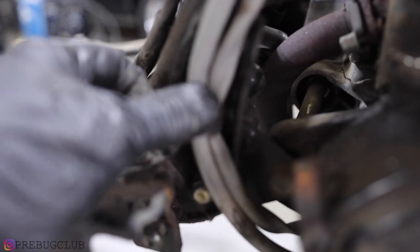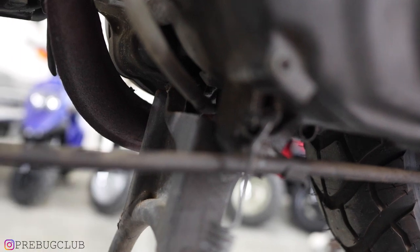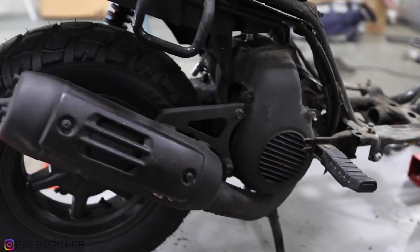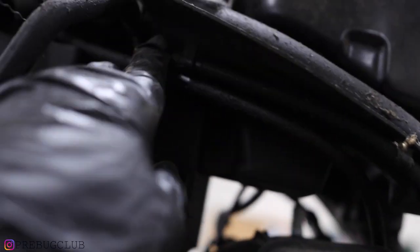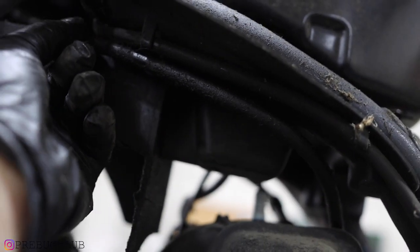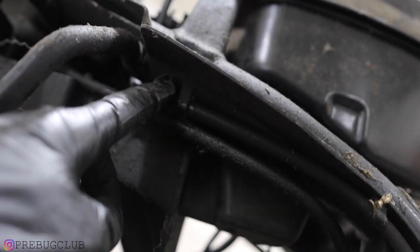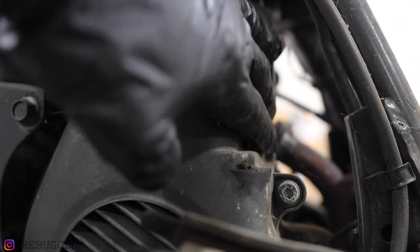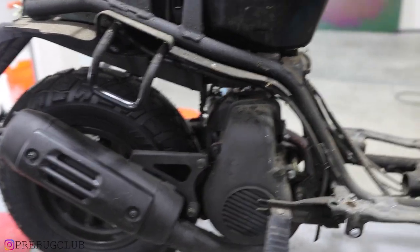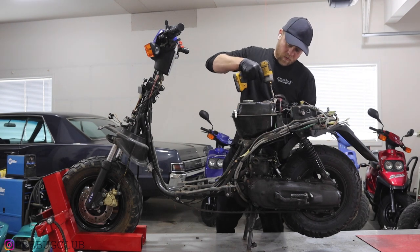The odometer cable runs through this piece over here. There's another tie down holding both the throttle, rear brake, and choke on the left side of the frame. The main harness is on the same tie on the right side, tied right at the neck. These three cables go in through this little guide, under this bracing strap. The throttle cable and choke cable come up and over this bracket. The brake line stays flat and runs all the way through this little rocker plate. The main wiring harness goes below this bracket and comes up through the spacing with a tie.